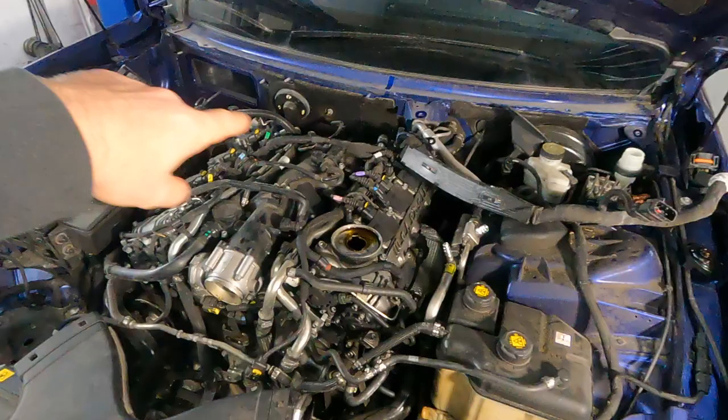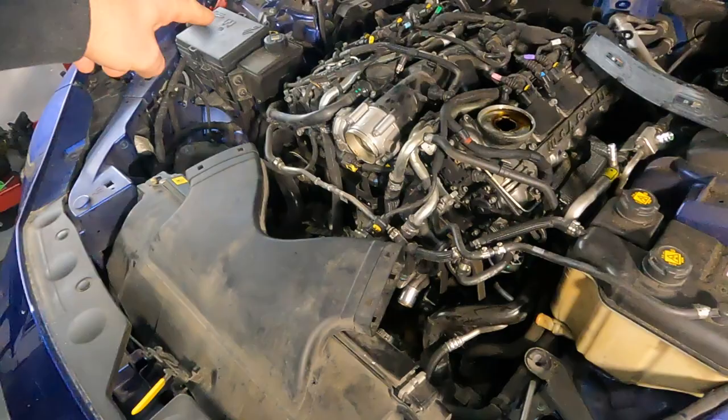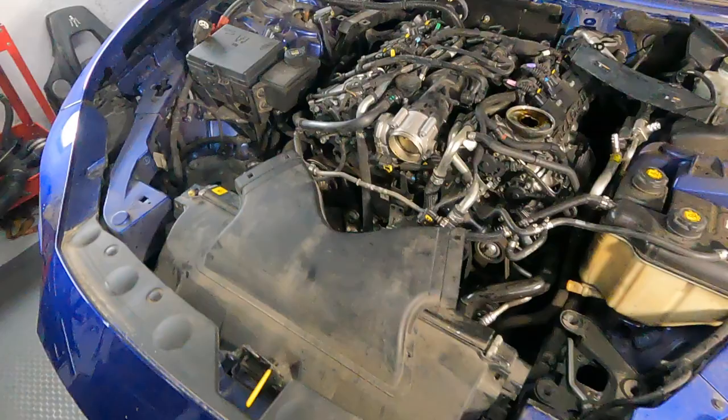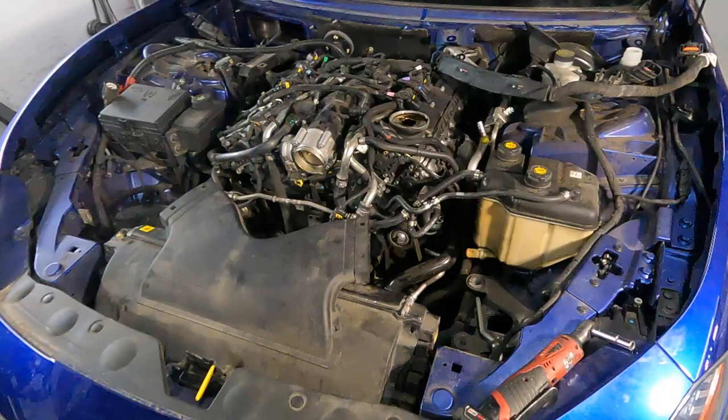You can see the harness. This is like a wiper blade motor, all plastic, and he is ready to remove the radiator, the valve cover, the harness and the intake manifold to have access to the timing chain. We are planning to keep the oil pan, I hope. Anyway, you can see all the procedure for that replacement and the timing tools and parts we are going to use